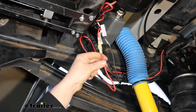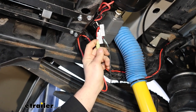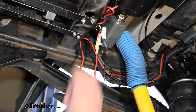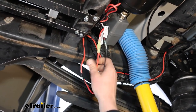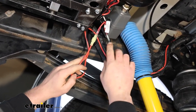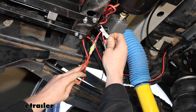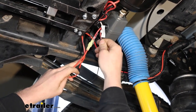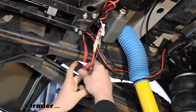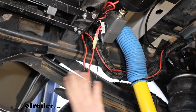Our two wires: the red one that came in our kit — the thick one hooked up to the battery — you're going to hook that up to the thick red wire coming out of the regulator, labeled 'connect to fused positive power source.' It's a spade terminal that clicks in. Then the new wire we ran — the black one coming off our upfitter switch — gets connected to the slightly thinner red wire coming out of the regulator, labeled 'connect to trigger/switch positive.' I just used a regular heat-shrink butt connector to pair those two together. And that wraps up our wiring portion of the whole kit.